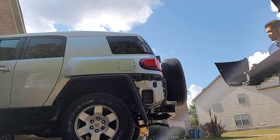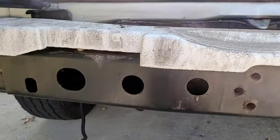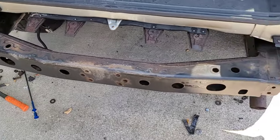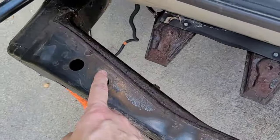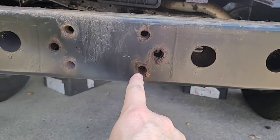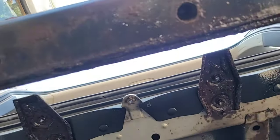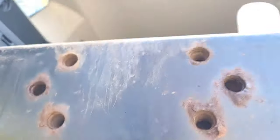It's relatively lightweight. There's a little piece of styrofoam that I'm going to remove from the top of the actual bumper surface itself — you can see these little styrofoam pegs that fit into the little grommet. Here's the bumper in all its glory. Some surface rust — I'll take care of that with fluid film — as well as the actual mounting positions. You've got six holes here; these inboard ones don't appear to have a captured nut. On the underside, there are two additional holes that are a little rusted, so we'll have to clean those up.